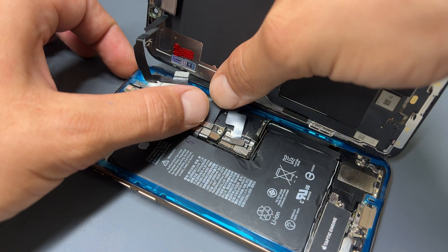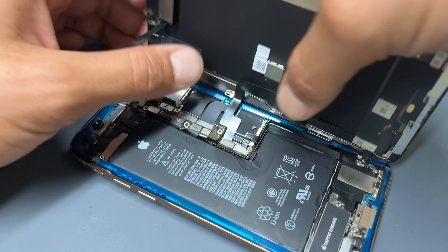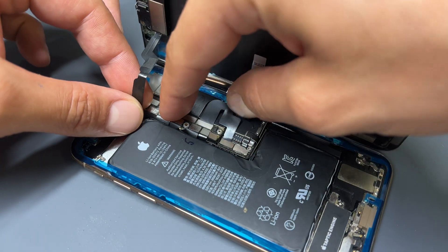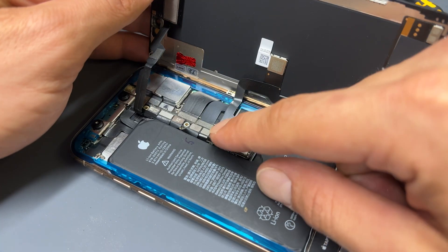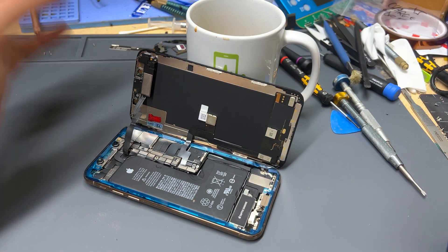Peel off the first film of the new seal and attach it starting in the top left corner, lining it up along the left-hand edge so that it aligns for the rest of the phone. Use a spudger to flatten the adhesive right into the chassis to make sure it's stuck all the way around, then use tweezers to peel off that first layer of film. We can now reattach the screen by connecting the three flex cables into place, then finally reconnect the battery into its connector. Pop the mug back behind the phone so that it doesn't fall over.